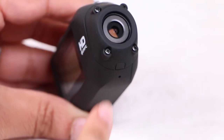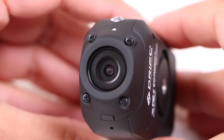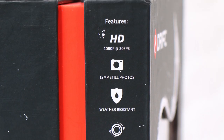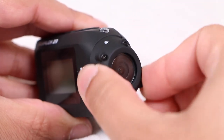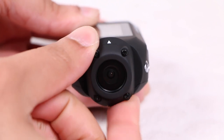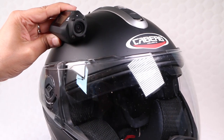At the business end, the Stealth 2 features a small microphone pinhole along with a 135-degree, 7-element aspherical lens concealing an Aptina 1/3-inch CMOS sensor. This provides full 1080p HD video capture at 30 frames per second, or 720p at 60. The lens itself can be rotated 300 degrees relative to the camera body, as is the case with other Drift cameras. This allows users to mount the camera in whatever orientation works best and then just twist the lens to straighten out the shot — one of the unique selling points of the Drift line of cameras, and seriously convenient.